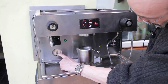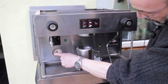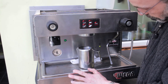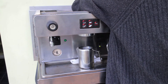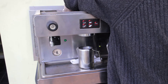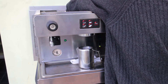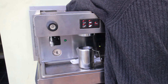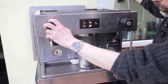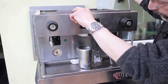There's clearly something amiss with the gauges — that needle should be down there and this needle should be up here, so I'll need to look at that. No big bang, no sparks or nastiness, no tripping of the trip switch, which is a good thing. The boiler — other than residual heat from sitting in the sun in the conservatory — I'm not feeling any heat coming from it as you would from an element, which indicates in all likelihood the element is shot. The steam wand and feed obviously require water and steam pressure. The shot buttons however should work because the pump should switch on.